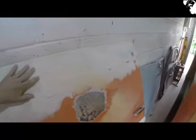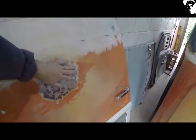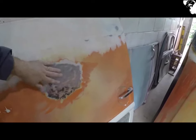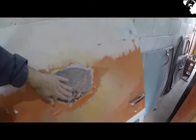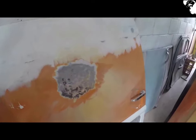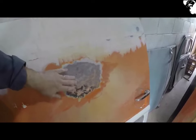Obviously put a little skimmer filler on there, still got to do a few more layers of that yet. But feeling the door, there's a real big dent right in the centre here — it's just where the cross members come across. I can't even get a hammer behind it, so shrinking disc it is — fetch that out a little bit and a little bit more filler on there.